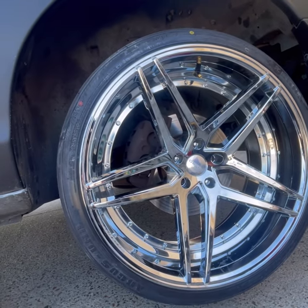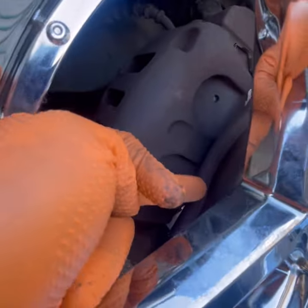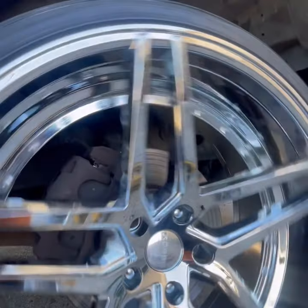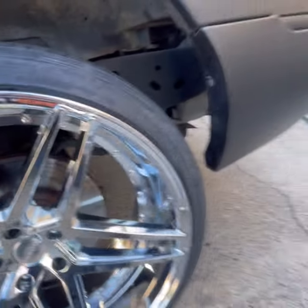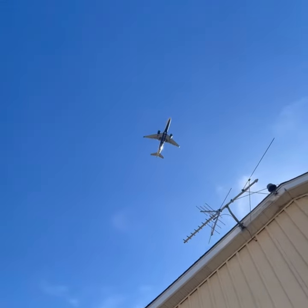Now that I had a wheel on, you want to check for any rubbing. Sometimes you'll rub right here on the caliper bracket. You want to spin it to make sure it's not rubbing on any upper control arms or anything. You want to check — you got your clearance. Sometimes you have the turning radius where you'll be rubbing on a caliper bracket or some of the upper control arms.